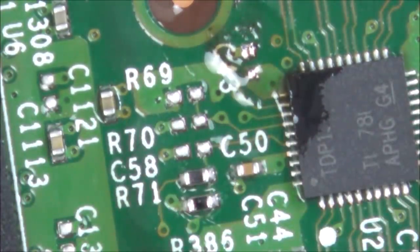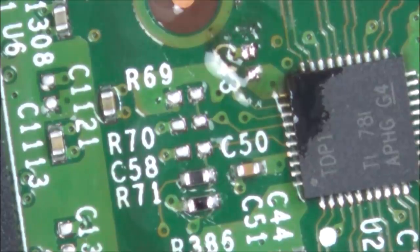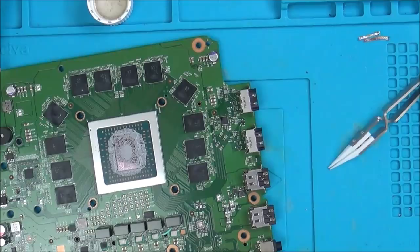Well, okay, managed to remove it eventually. Now, because this board is so hard to work on, I think with the resistors I'm just going to measure what they are rather than take them off, because it should be accurate enough. Then I can put resistors on the other board I think are the same, and if they measure differently, then I can take them off. But if they measure the same when they're on the board, then I'm happy to use them, because normally you can measure resistors in circuit.